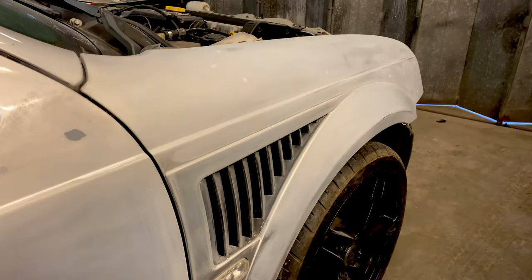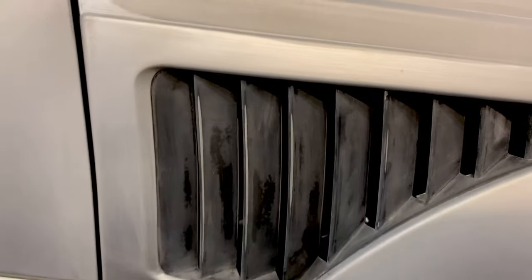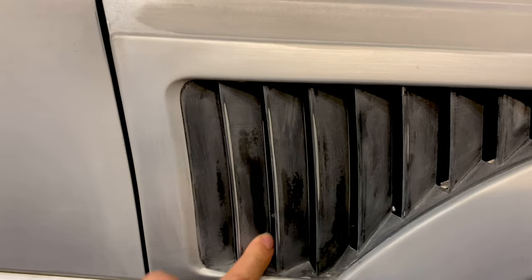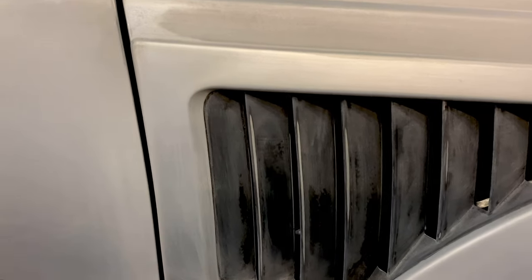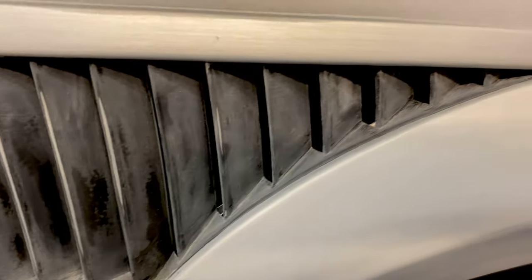Got a little bit there, it's got a bit of peeled lacquer, see? You need to make sure they're blended in or they'll stand right out. Right, so time to show you what I've just done. It's a bit close because I'm close up to the wall here. There's not many more bits where it looks like I haven't done these bits. I have, that's where I've gone through the lacquer. In the spray booth, pull a sheet over it and get some prime on the bits that need prime.